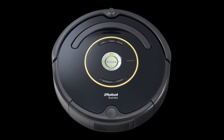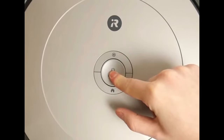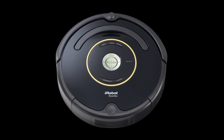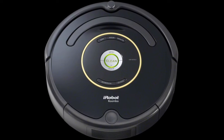After cleaning the Roomba, if the error continues then follow the next solution. Solution 2: Reset the Roomba. Turn off the Roomba and unplug the charging dock. Wait for a few minutes, then plug the dock back in and turn the Roomba on. This can sometimes reset the sensors and resolve the error. If the error continues then follow the next solution.